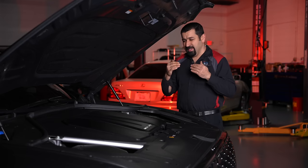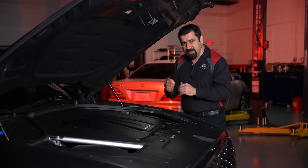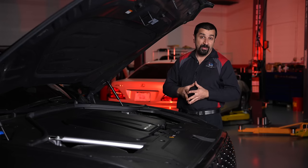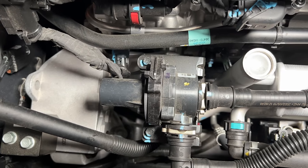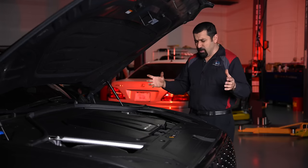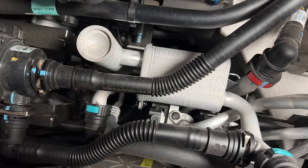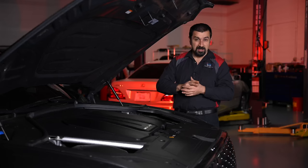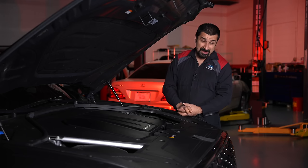While this system is more sophisticated than some electric cars — it has cross-communication between the two cooling systems and HVAC to exchange heat as needed — it is not to the level of Tesla's octo valve, for example. This car has a series of three-way valves, some two-way valves for the cooling systems and refrigerant to keep things efficient. I wish they had condensed all these valves and hoses into one unit, like Tesla did with their octo valve, so you don't have 17 separate things distributing — just one unit where everything goes in and comes out. That's where the magic is with Tesla's octo valve.